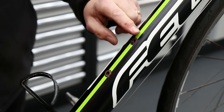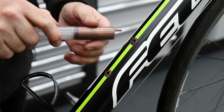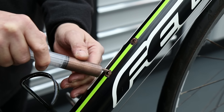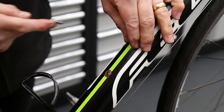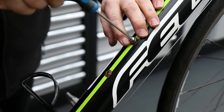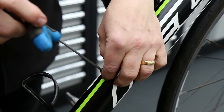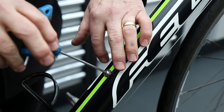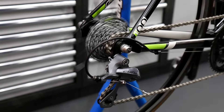Another little detail I noticed: there were accessory bolts missing on the frame and they had started to go rusty. I popped a little bit of copper grease on there to prevent any dissimilar metal corrosion between the two components. I put new stainless steel bolts in there with a little washer to cover up that rust — just a small detail to present the bike a little bit nicer to the customer.